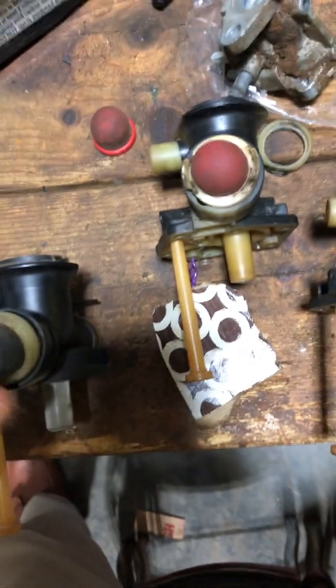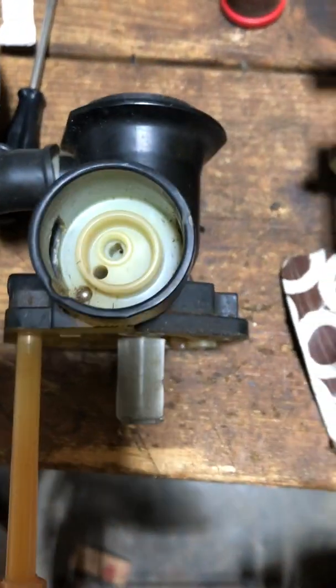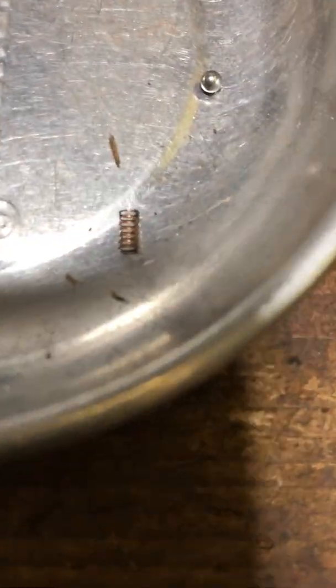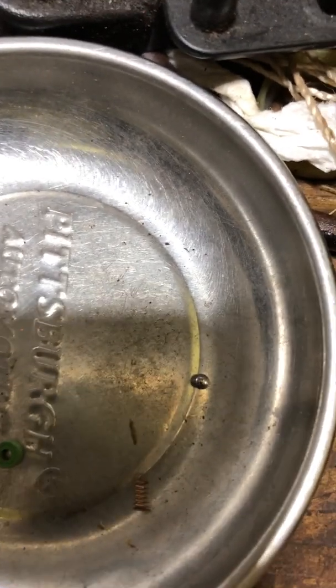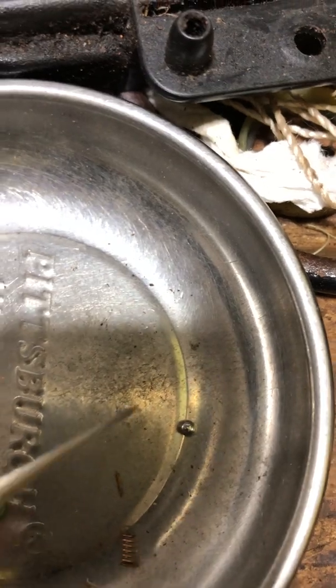Here are three carburetors in different stages and you'll see what I'm talking about. This carburetor here — I have removed the needle seat, which is this little green object right there. You'll be familiar with that from working on Quantum carburetors; it's almost identical to the needle seat you would find in a Quantum carburetor. And under that needle seat is that tiny spring right there, and that spring has to be compressed from pressure that you apply when you press the primer bulb.